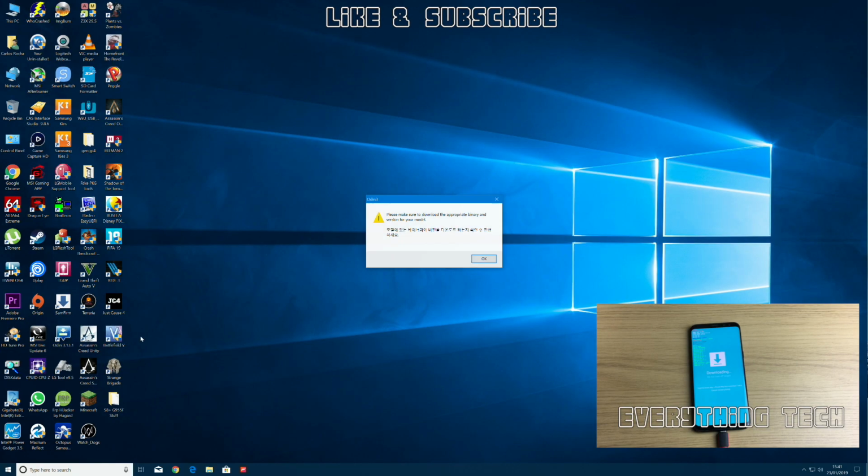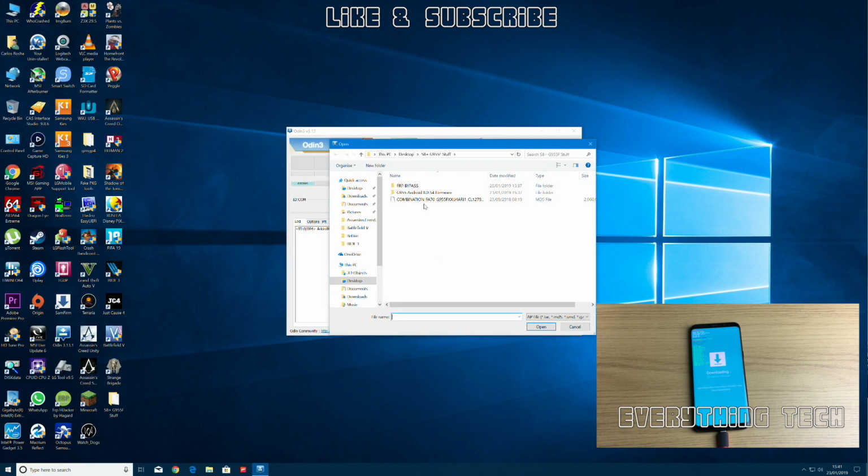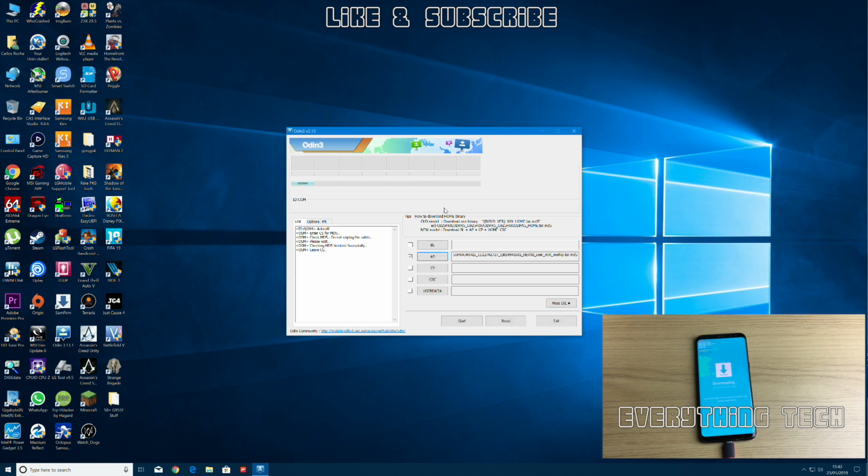So let's go on the computer and we're going to launch Odin 3.13.1 and load the combination firmware in AP. Just follow the guide exactly like I'm showing you on the screen so you won't have any problems. So this bit will take quite a bit of time, but I've sped up a little bit, and then once you're ready just click start. This will go through a long process, but I've sped up this part of the video so I won't bore you with the time that it takes to do this. Just be aware that this will take quite a bit of time.